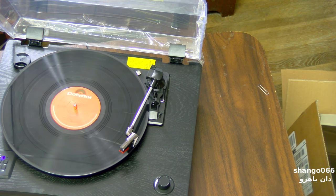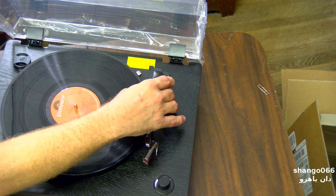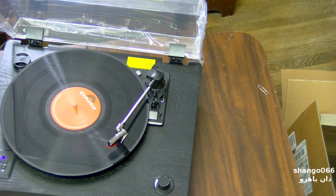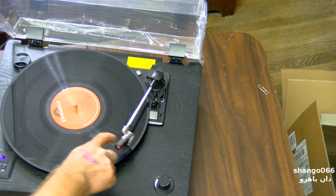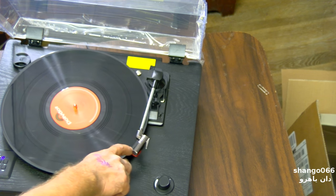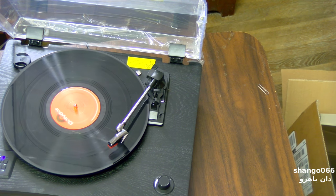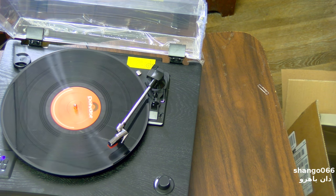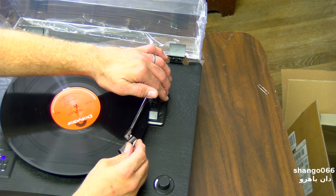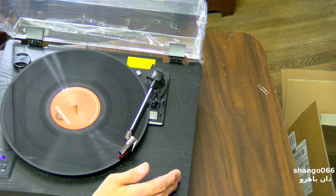Another issue that we notice with the tone arm cue lever is that when it's engaged, you can't engage it without the arm swinging out and the motor turning on. Yeah, it's like it's spring-loaded here. And it doesn't swing out to the beginning of the record. You're ending up a good inch past the start of the grooves. So you're kind of fighting a spring-loaded mechanism there, which is difficult. You have to bring it back and drop it. And yeah, then it's just no easy way to start it at the beginning of the track. So you end up having to start it by hand.